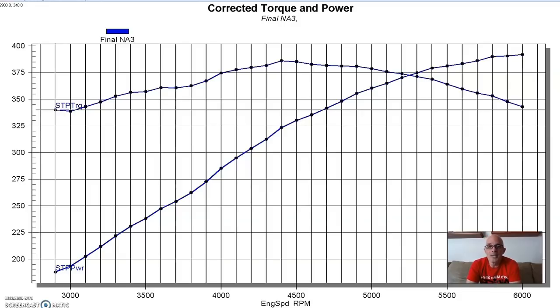You can adjust the speed of the impeller through pulley ratios, and sometimes they can reach 50, 60, 70,000 RPM on high horsepower race blowers. It's important to note that the centrifugal blower does not have the same kind of boost response that the roots blower does - and you'll see that in the power curve.